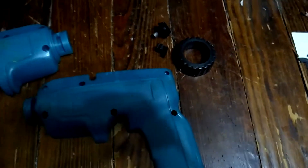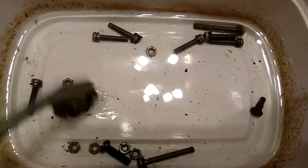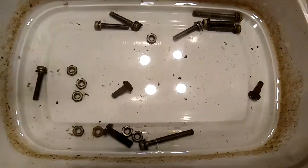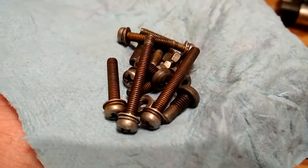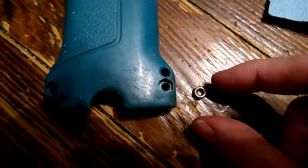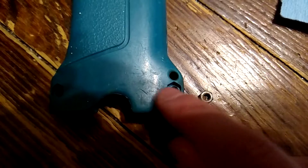Also remember to clean your other plastic bits. Now I'm going to use some super glue, also called CA glue, to glue on some plastic parts that kind of snapped off around the screw holes. I'm also going to use super glue to set the sticker back on, since the sticky stuff is all messed up now that I pulled it off. After a day in the vinegar solution you can see all the dirt coming off - scrub them down, wash them off, dry them up. Look at that - the hardware looks brand new! Now I'm going to put the nuts back into the holes. Remember the orientation actually matters.